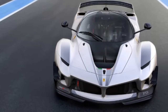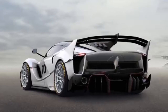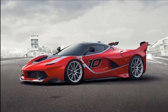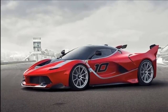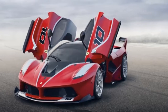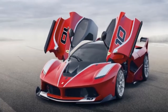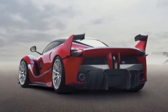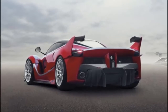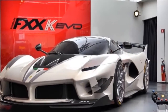This package basically pushes an already amazing car to the very limit. The aero enhancements modify the FXXK's appearance a lot, starting with a more menacing front end. The geometry of the sides of the front bumper was altered by hollowing out the surfaces beneath the headlamps, as well as by adding a couple of flicks divided by a vertical turning vane. There's also an additional intake ahead of the front wheels. All these elements contribute to a 10% downforce gain over the standard FXXK. Ground effects were also boosted by new vortex generators in the under tray.